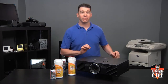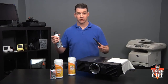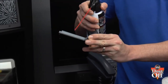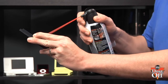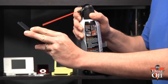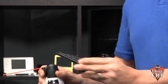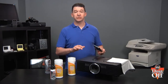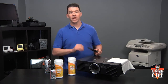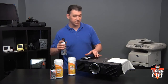After removing the projector cover and taking out the filter, apply short bursts with the duster to blow away dust from the filter. Before you reinsert the clean filter and close the cover, make sure that you also remove all the dust and dirt possible from the projector cabinet — the area where the filters are inserted — by using the same duster to blow the dust out.